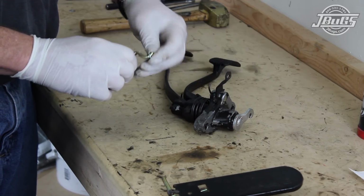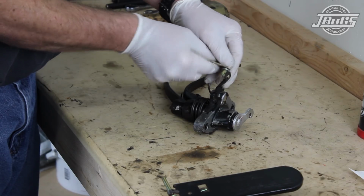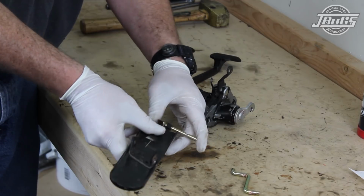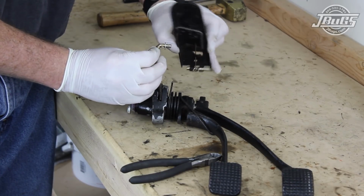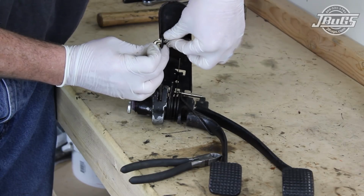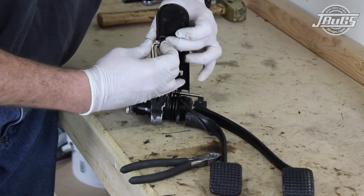A washer is slid in place onto the double bent end of the accelerator pushrod and then pushed into the pedal lever on the pedal assembly. The accelerator pedal would then be mounted to the floor pan with a pedal pivot pin with the spring set in between the two pedal mounts. Another washer goes onto the opposite end of the pushrod and that end installs into the pedal itself. Then the spring clip is pushed over the rod and clipped into the groove on the rod.